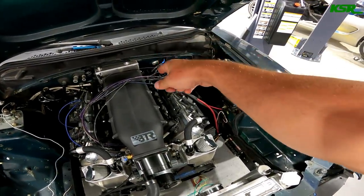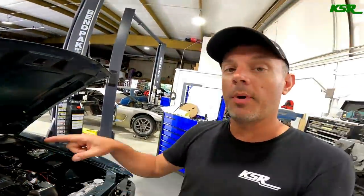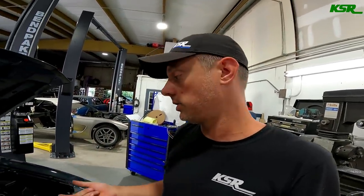I still have to add the oil pressure sensor — I'll zip tie it or at least mark where it lines up with the cam sensor wire — and also do the crank sensor. I'll run the car up in the air, loosen the starter, pre-terminate the crankshaft connector on a piece of Holley's shielded three-wire cable, then pull it out, heat shrink it, and it'll be done. After that I can go ahead and terminate at least the engine side of the firewall connector, then worry about the chassis side once the harness is run from the ECU.